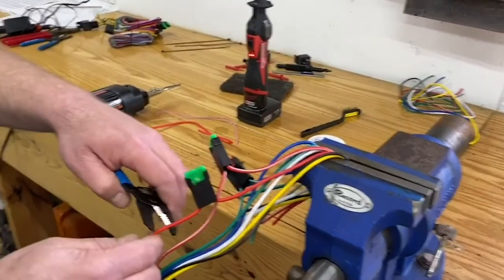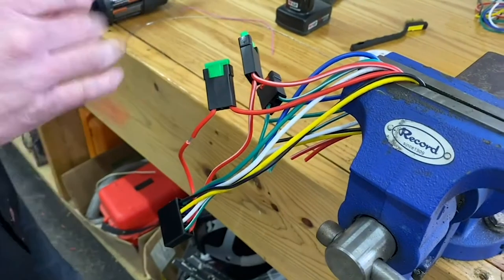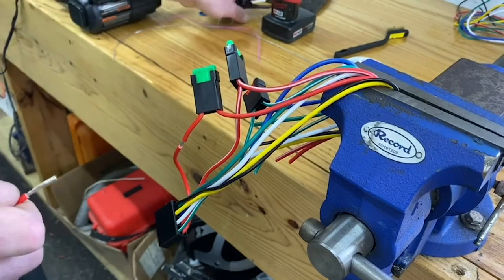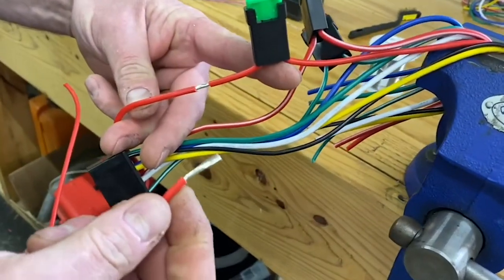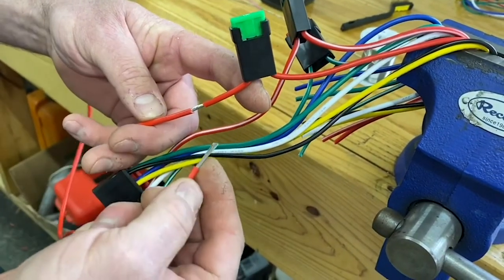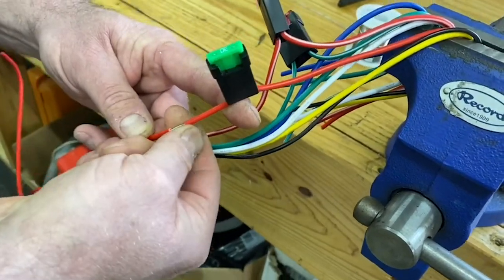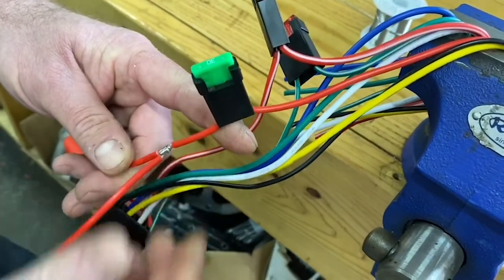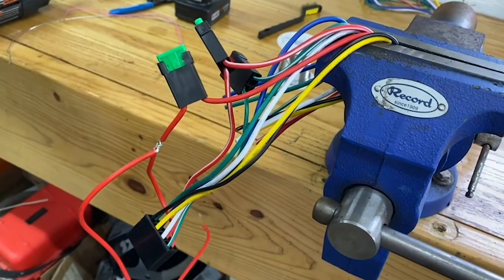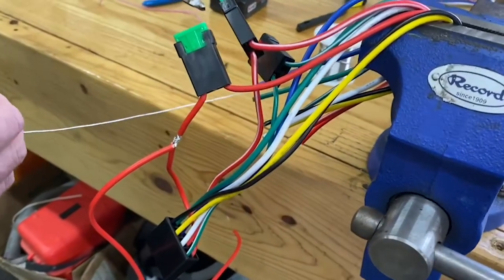I'm going to show you what it looks like to get a good solder joint. For heavier gauge wires — main primary wires on the heavy gauge harness — I make sure not to twist those wires on the piece being soldered to the main line. The wires will fit a lot better and tighter without twisting; if you twist them they tend to pull away, making it harder to get a good solder joint.